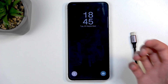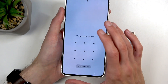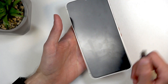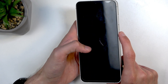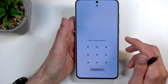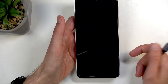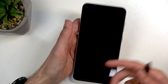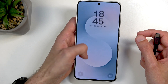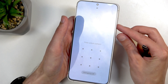For the removal of a screen lock, you will want to hold your volume down and power button, and you can plug in the cable right away. While holding them, interact with the display so you can see when the phone actually forcibly turns off or restarts. If you don't interact with it, the screen may time out and you might mistake that for the device turning off. Make sure you interact with the display so you can clearly see when it actually turns off and is no longer responsive.